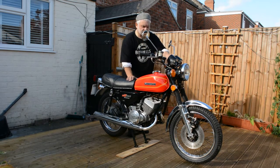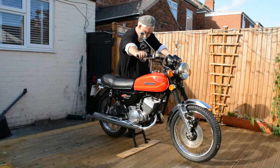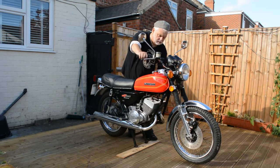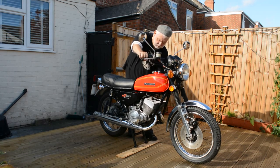You may have also seen on some of the videos we put together, the carbs were cleaned and rebuilt with the correct jets, because they are a little bit different on the B models. And then the carbs balanced again. We did a short video on that, as you probably saw.